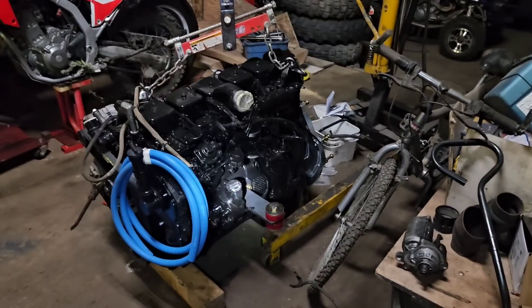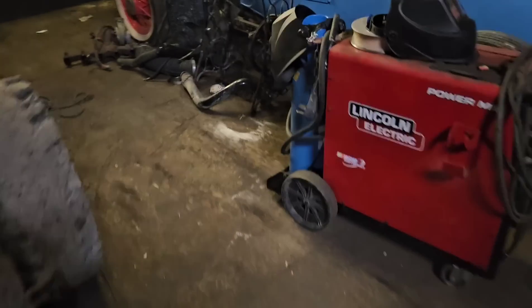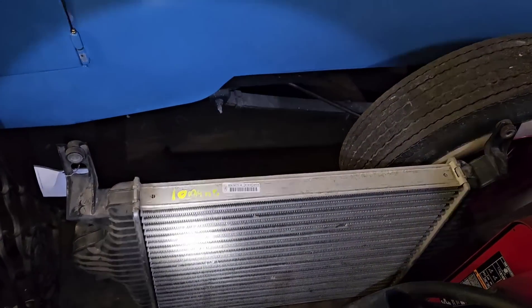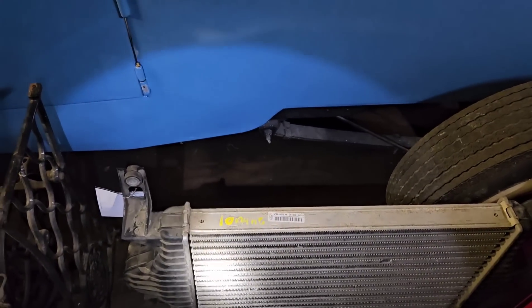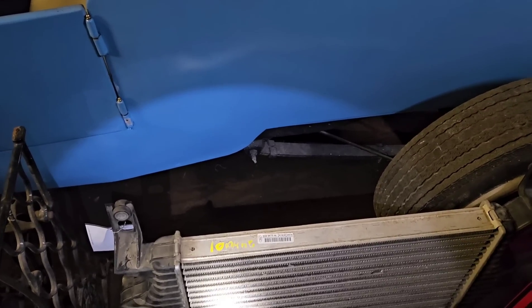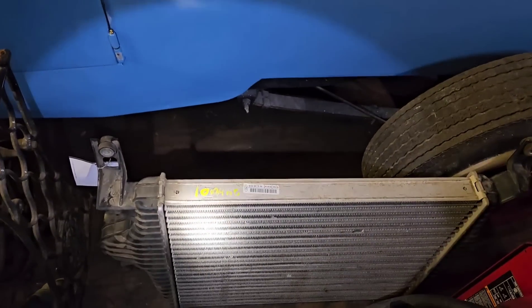The hardest part of this job isn't even the engine — it's the intercooler. A lot of meat has to be cut out. So ahead of time, if you're doing an OBS Ford swap, order yourself a 6-liter or a 7.3 Powerstroke intercooler. The Powerstrokes had an intercooler after 99, I believe — it might be after 98. But you need one of those intercoolers. Either one will fit. This is a 6-liter one.